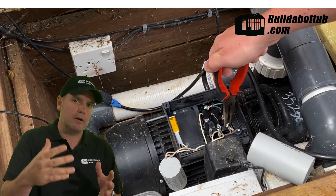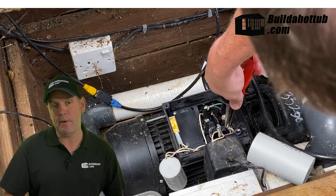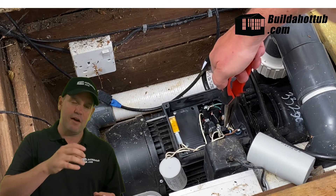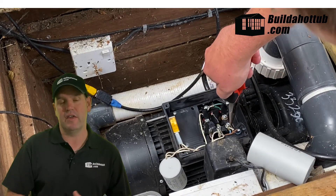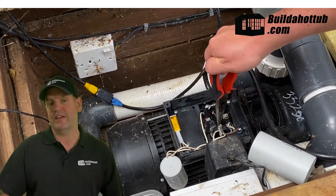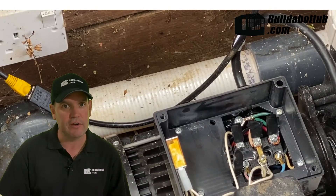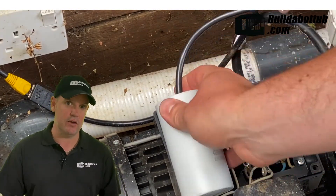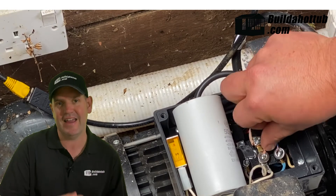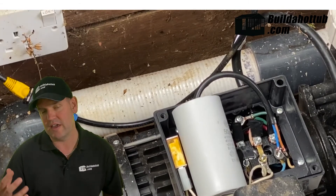The capacitors just sit in series with your electrical terminals in the top of your pump. All you're going to need to do is, with a wrench or with a small screwdriver, undo the nuts so that you can remove the capacitor. Put the replacement in and do the reverse — it's really, really simple. Screw the capacitor back into place, put it all back into the housing, and this procedure is the same whether you're replacing the run capacitor or the startup.